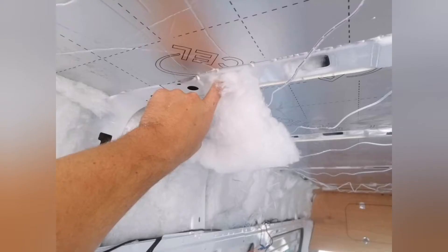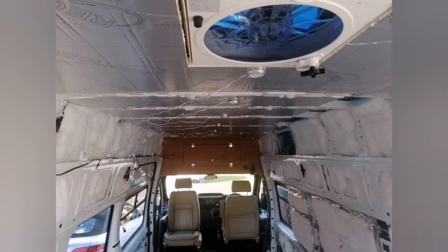For the ceiling I used Celotex board, 25mm, because it fit in between the ridges in the van roof. The boards sit flush to the metal ridges, and I also pushed some recycled bottle insulation into the ridges — it might be overkill but the more insulation the better. You can see the extractor fan, and the insulating board comes flush to it. The roofing will go on and I can put trim around the fan to finish it off nicely.